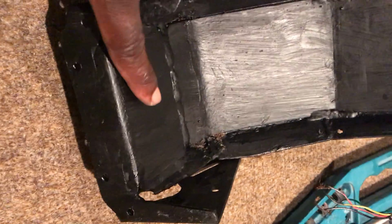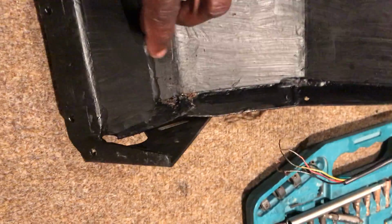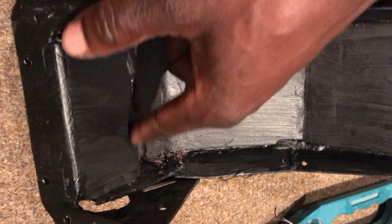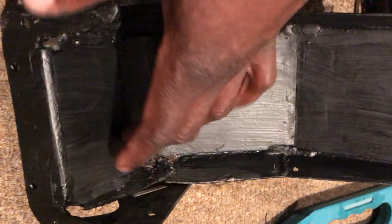But you have to make sure that the plate is bent from this side, right to that side, go up to that side, and instead of tacking it where we tacked it initially, it broke exactly where it had been tacked, because the hot fire going right there kind of weakened the material. So the material just broke exactly on the same plate that had been tacked.